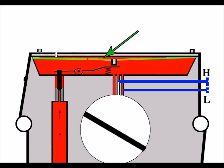And normally on the metering diaphragm cap, there's a little air hole. And the purpose of this little air hole is to act as a breather, which allows air in and out behind the diaphragm as it moves up and down. So we don't get any pressure building up of air behind the diaphragm. So there won't be a vacuum behind the diaphragm stopping it from coming down, and there won't be pressure behind the diaphragm stopping it coming back up. This air hole allows the through road, if you like, of air and free diaphragm movement.